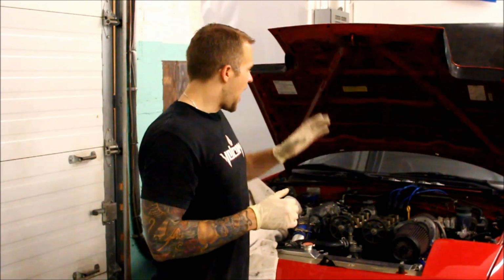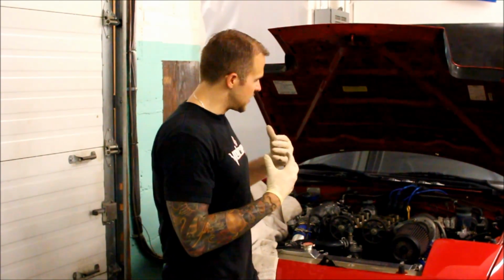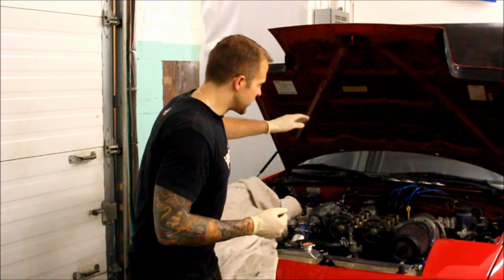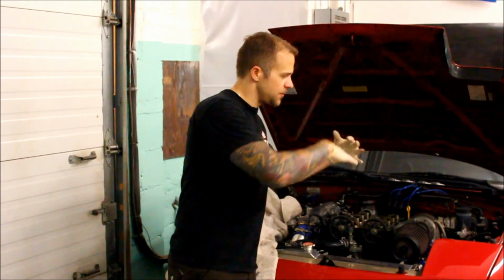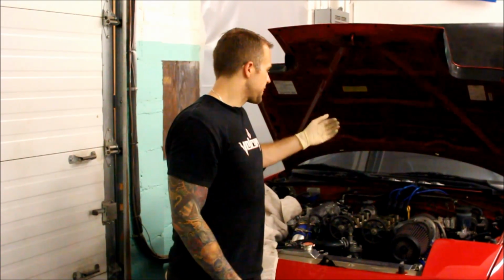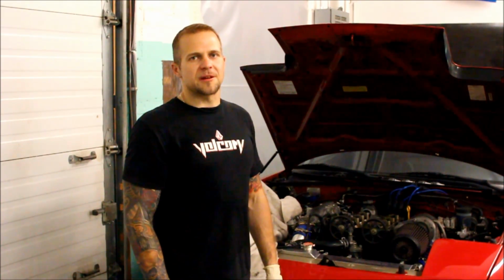I've already taken all the exterior stuff off. I'm going to start this installation by removing the cam holders. You want to loosen them in increments from the front going to the back, because the cam comes out on an angle as you torque them down, and we'll go from there. We'll get to the next step in a few minutes.